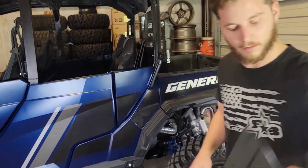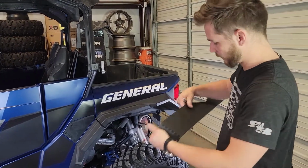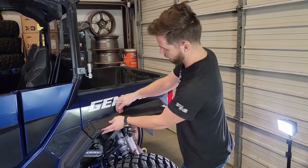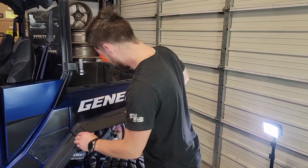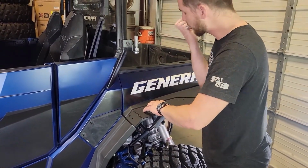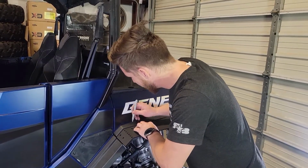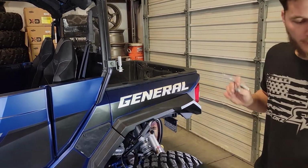Put that back on the cart, grab our main A body, and we'll bend the flange up front, and we'll bend the flange on the rear. And how you can tell the front is it will align with the angle inside the fender. So now we'll get that into position, align that with the crack again, starting from the front, hold it in place. Now we'll mark it with our Sharpie. Once you're done marking all the upper holes, we'll just put that back on the cart.